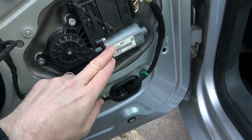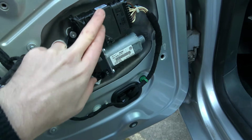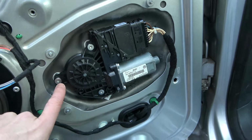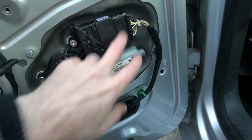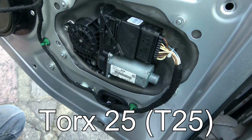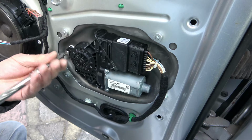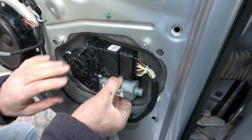So it's not the motor or the gearbox for the window that's faulty. It's the actual circuit board in here, which is faulty. So we're now going to undo these three screws, this one, and this one, and this will now pull out, and then we can undo the wiring connector. And for these three screws, we're using a T25, a Torx 25. Now we're just going to wiggle it out,